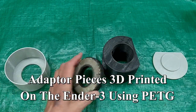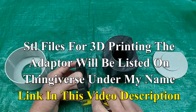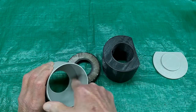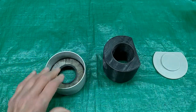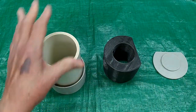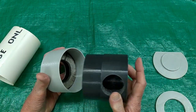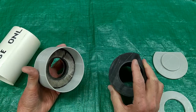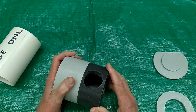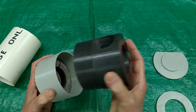So now I have all the pieces made. I sanded this flat on a belt sander and it's roughly 5/8 of an inch thick. It will be sealed in here with silicone — put silicone around this edge here and shove that down in there. Got another washer that will go in there. Put a weight on there and let that silicone set up. When that's done, this piece will be sealed in here with construction adhesive if I have any, or silicone again. Put that down in there, turn it, make sure everything is sealed up good and tight, then put a weight on that and let it set up.